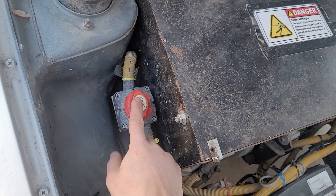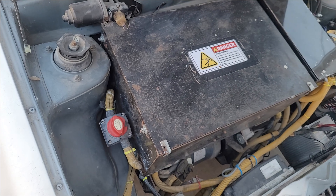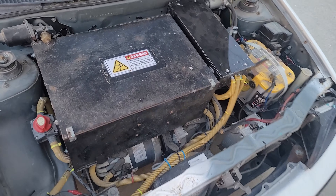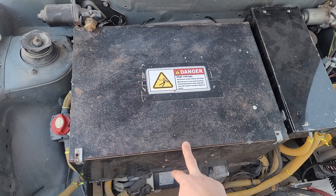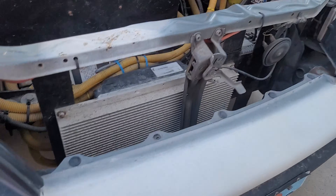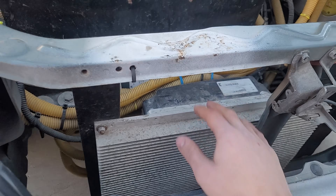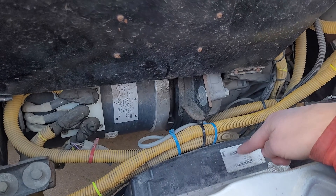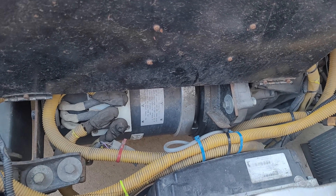This is just a battery cutoff switch to lower the voltage for safety when you're working on it. In terms of cooling, it's all air-cooled. Gen 2 Nissan Leaf cells can go up to about 52°C, and they can also be charged below freezing — they're one of the few cells that can do that. You can see where the radiator used to be is now a heat sink for the controller. There's temperature monitoring on the battery cells, the motor, and the controller. Even on the hottest days in summer driving 65 miles per hour for 15 miles, nothing gets too hot.